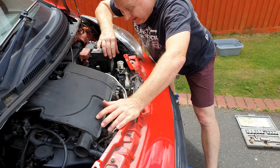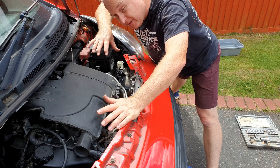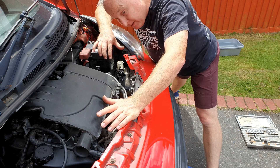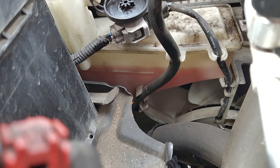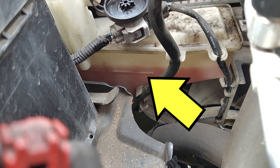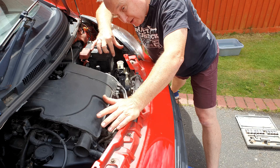This C1 is actually an excellent example of how you might not have drained all the coolant out of the system. Although I've drained the coolant at the two points given in the workshop manual, the expansion tank has not been drained and is still full of old coolant, and there are no instructions in the workshop manual for how to drain the expansion tank in particular.